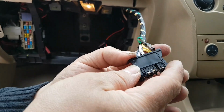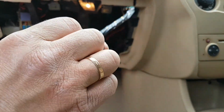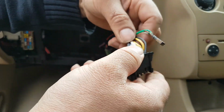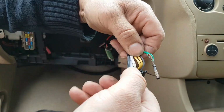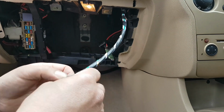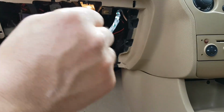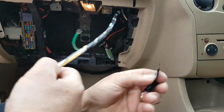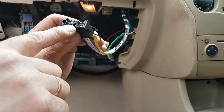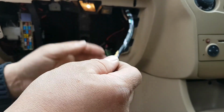And look at that guys, look how this is. And I think this wire has melted through and was shorting this green wire with that yellow one in there. Look, I think that's what was happening. So let's replace this pin here. I should have some spares in there from old plugs. Let's replace these, redo all this, and put a clean stuff here. All the other ones are okay, properly cleaned. It was only this one that started to end. So let's replace this and go from there.